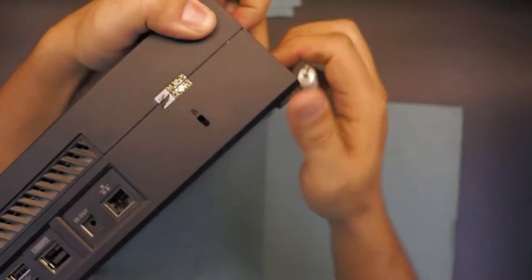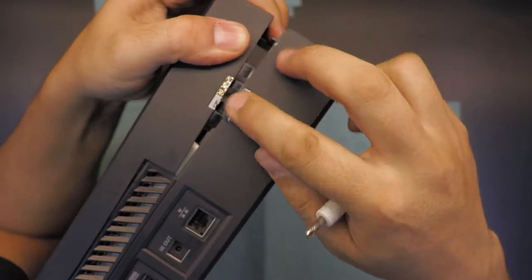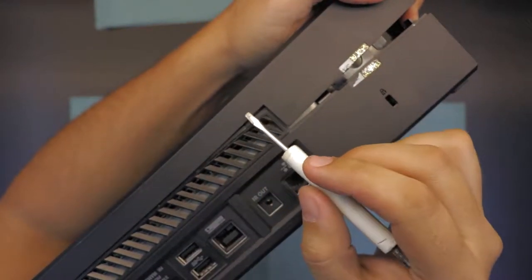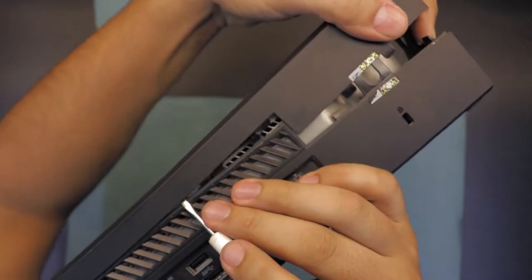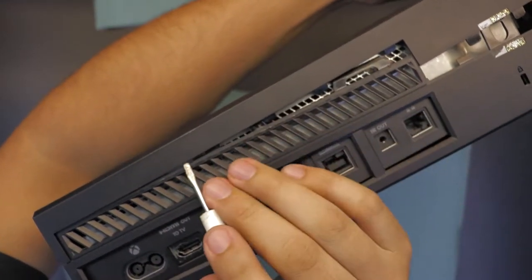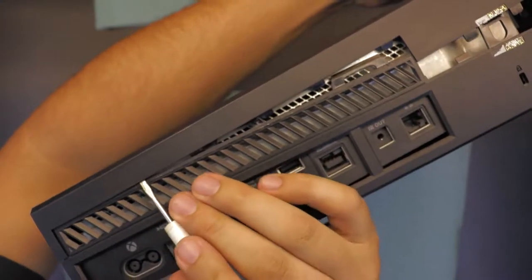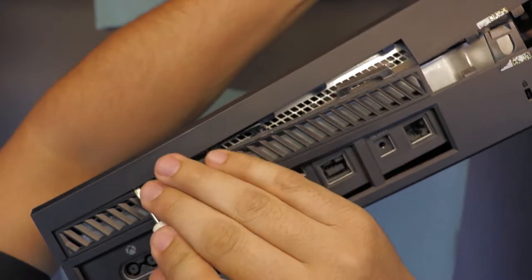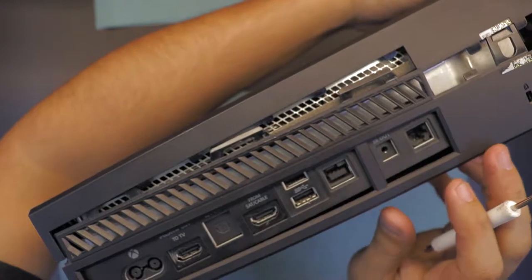Pull down and then pull out — you have to use two hands. Once you have a gap, grab your flat screwdriver, put it right in there on top of the grills and move it slowly while pulling apart. Do this all around. Note: if somebody already opened it before, there may be a tiny dent — that's normal.